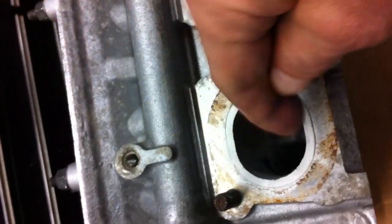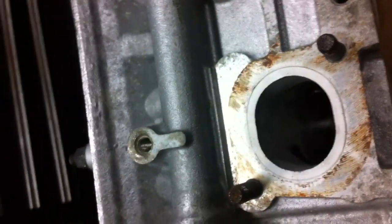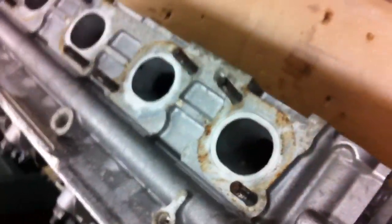That's how complicated and tough this is — it's very hard. Some people recommend running a chemical cleaner and filling it up through the valve so it fills the tube and comes out the holes. But the carbon is so hard and so compacted that it just doesn't seem to work its way through. The only way to really do it is to remove the head. These holes are angled in towards the valve, so the only way to clean them is to remove the valves with the head off and then clean from the bottom side of the head, going at an angle to hit the holes as they were drilled from the factory.